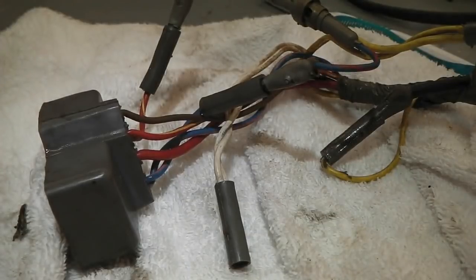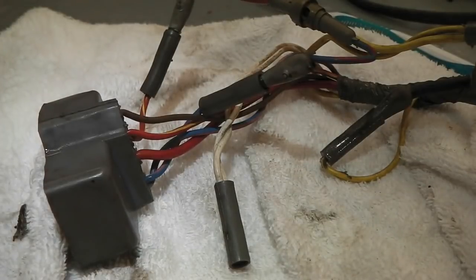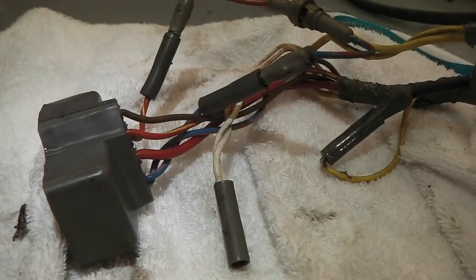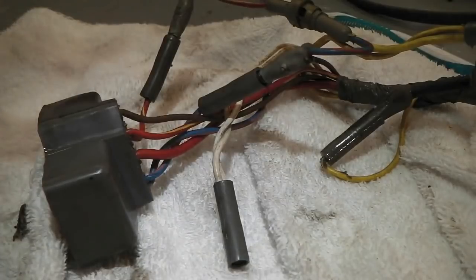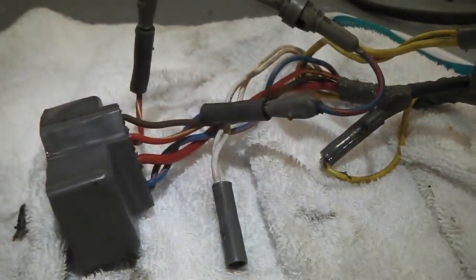If you flip to high beam, high beam would keep on the dip beam, so you'd have all four lights. Then when you take off your high beam, you just get the middle pair. If you don't have your dip beam on at all and you're flashing someone at a junction, in daylight with your lights off, you pull your high beam and it only does the outside two. So this diode creates it so that all lights off, high beam on, only does the outside two. Lights on, dipped, dip only. High beam on at night, dip and high beam, all four. That's what that diode does. Not all cars had it. There you go.